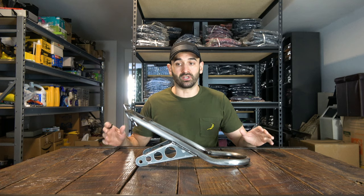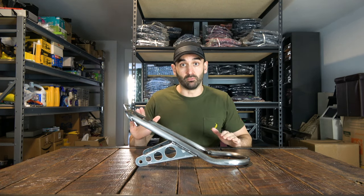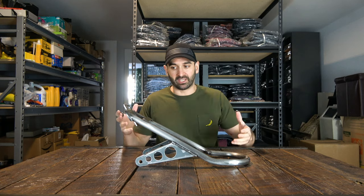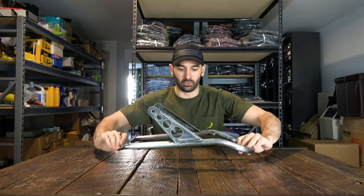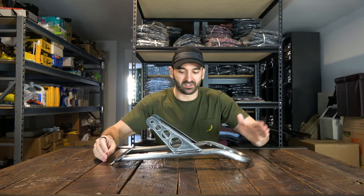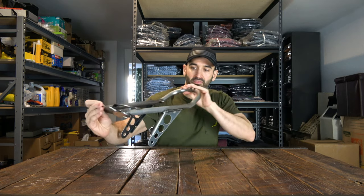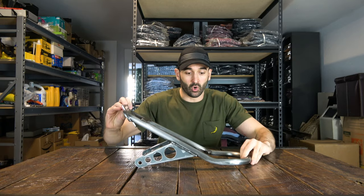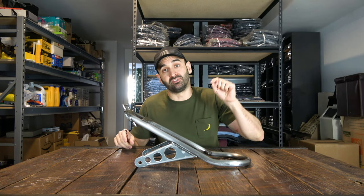This is all finished — I just did 600 grit. Usually I would have done 600, 1200, and move on like that to have a very smooth finish, but because I'm gonna paint again I'm not just gonna buff it. 600 is good. I need to repaint because of those two areas that were touching in the oven where the paint is missing — that's the only reason. When I look with the light on the reflection I can tell my runs really disappeared. So just one coat of paint on this and I'm done with the painting.